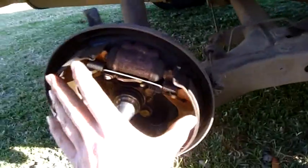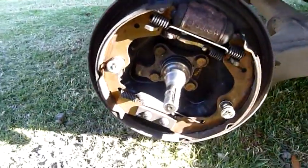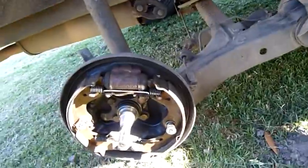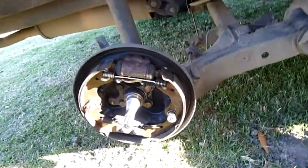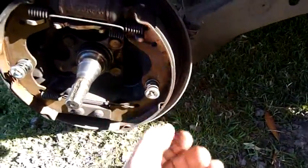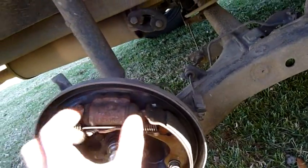The inner race has been spinning on the shaft too - it just fell off with no resistance whatsoever. And of course, these two brake shoes - on hydraulic it actuates both of them, pushing them both out and spreading them into the drum. On manual park brake it only seems to move the rearmost shoe, pushing it out to the drum and locking it in. That's probably better than having a separate brake on a tail shaft, which this doesn't have. So it has no other option but to use these brakes as a park brake - you don't brake the front wheels for your park brake. Those pins just keep it all in place. You have to rotate that collet and pop that out to remove the shoes. That's your brake slave cylinder - when you depress the brake pedal, hydraulic pressure comes in and there are two little pistons that spread out and push the shoes out.